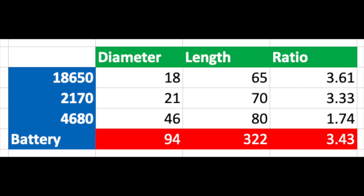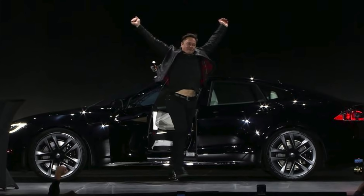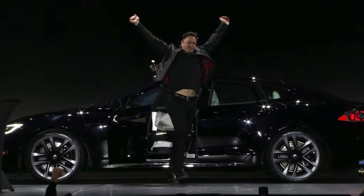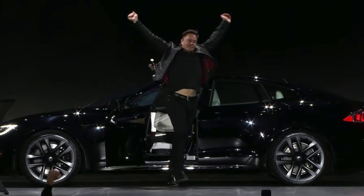Therefore, the Plaid is most likely using the 2170 form, right? Well, the images were not great, and the angles possibly didn't show the entire battery — in other words, these measurements I took, I believe must have been minimum dimensions. But given the diameter is of a circular nature, it is likely to be the more understated figure rather than the length. That would mean that if any of these Plaid battery ratios exceed the 2170 ratio, then it must be the 18650 form factor. Therefore, I am now placing the highest probability on Tesla using the 18650 battery form.